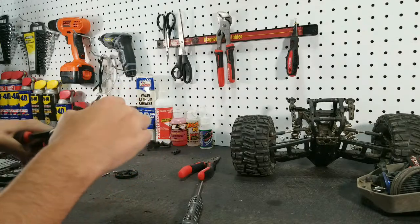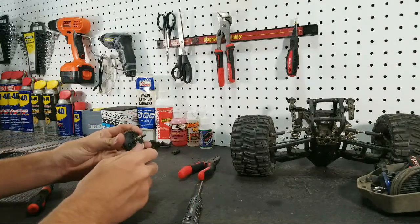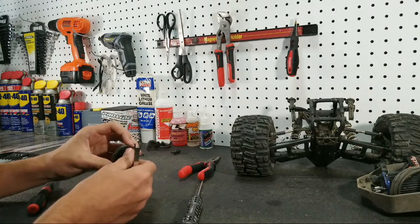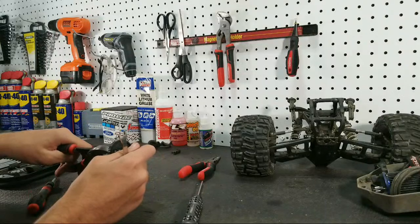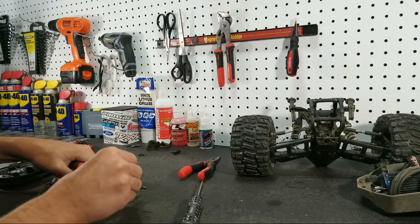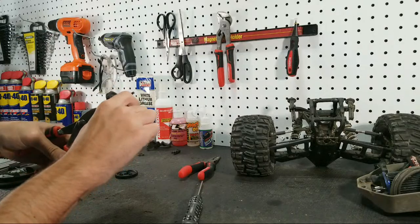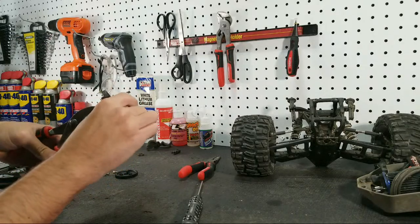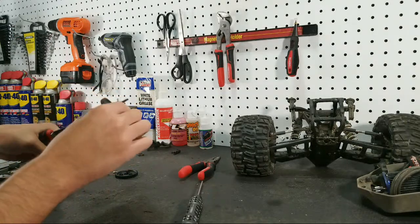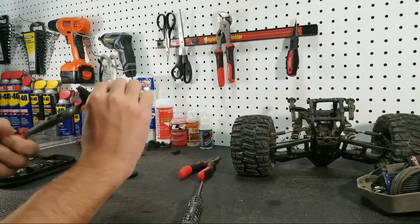One issue that I do have a lot with the slipper on my Stampede is it coming loose. If I don't put a ton of Loctite on this nut, it just comes loose, and then it has no power. It's kind of annoying, because I usually don't put any Loctite on that nut on any other car, and it works just fine. Oh, snap, I'm tightening. Didn't even realize.